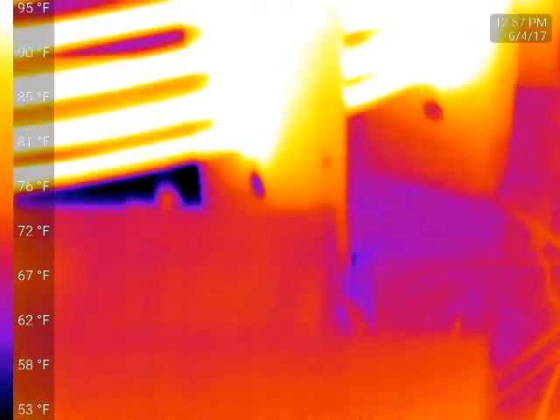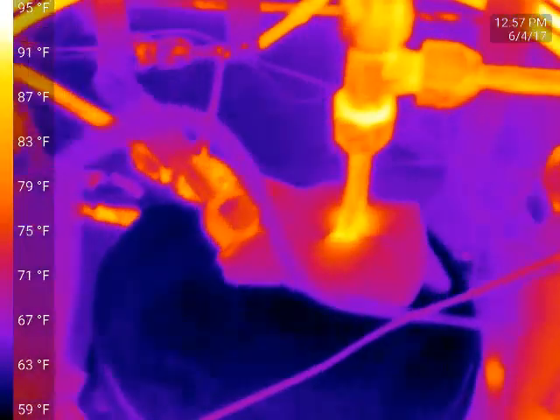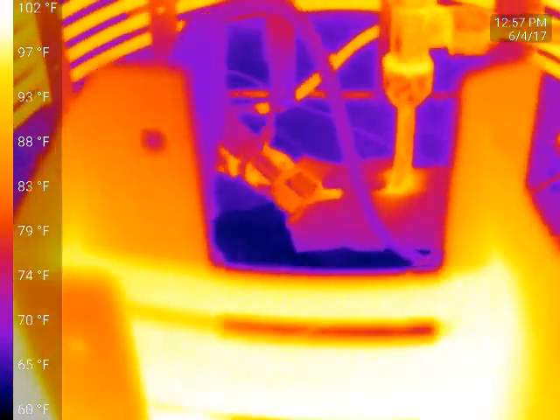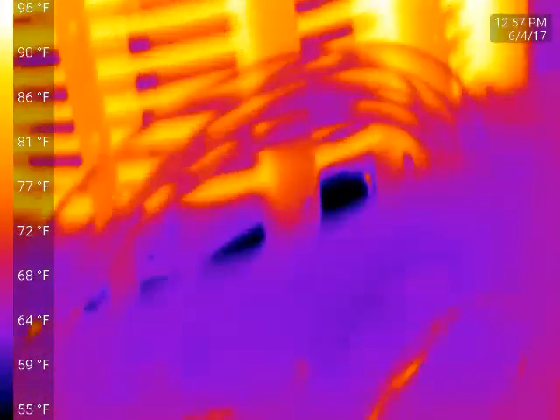The copper tubing here is the cap tube. I can feel the temperature difference there, so I'm going to be able to see it as well. The thermostat hasn't been running very much, but there is a warm spot that shows up there. The compressor is still showing pretty cool, but after it runs for a while, that thing will get red hot as far as the thermal camera is concerned.